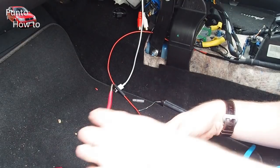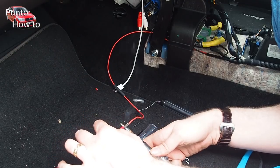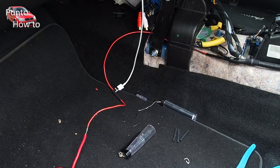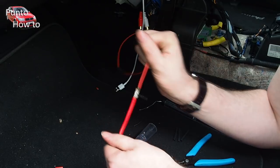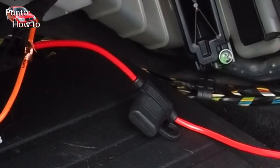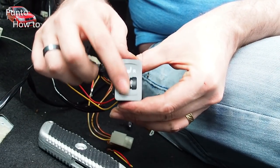This set didn't come with any sort of fuse, so we bought a simple fuse holder rated well over and above what is necessary for the heated seat set. We soldered the length of wire from the fuse holder to the end of the wire for the heated seat main power feed. We add a drop of solder to each end of the wire, and we've already threaded some heat shrink onto the wire itself, so once we have joined the two wires together we simply heat the heat shrink to make a joint that is nice and strong and fully insulated so we won't get any short circuits. We then attach the other end of the fuse holder to a large switched ignition live underneath the dashboard that we metered out, solder that in place, insulate it, and tuck it out of the way. We make some test connections to plug in the switch and confirm it lights up and switches on the heated seat elements.